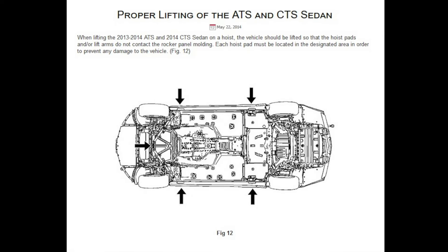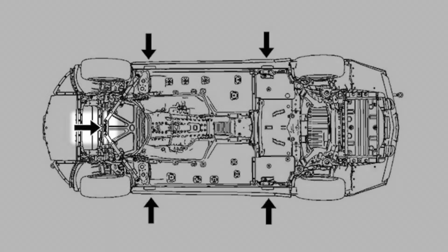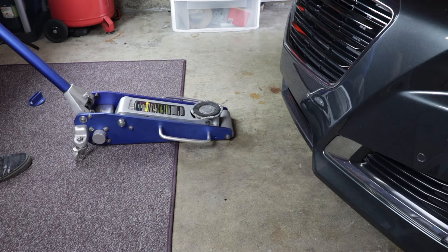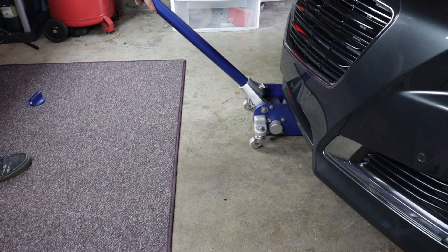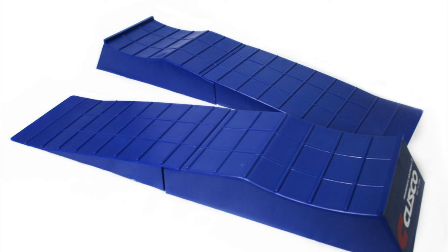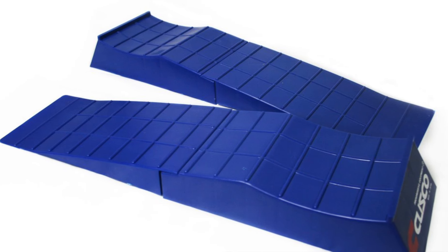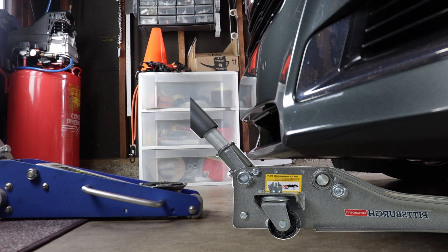Now let's get to raising the front of your Cadillac. The easiest way is to use the centrally located jacking point under the engine — you may not have noticed it was there. It's just that little rectangular rubber pad under the engine. If your jack is low enough and long enough, all you have to do is slide it under the nose of the car and raise it up. Unfortunately my car is lowered and my jack is too tall and doesn't have the reach to get to the jack pad. So one thing you can do is drive up on ramps or even small planks of wood just to get a little extra clearance. If your jack still doesn't have the reach, you can get one of those long heavy-duty jacks and slide it all the way under your car and jack it up right there.